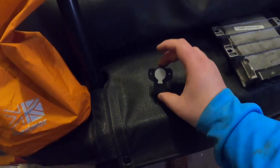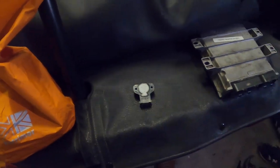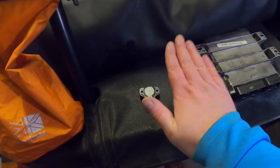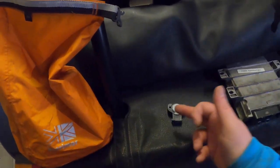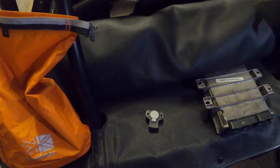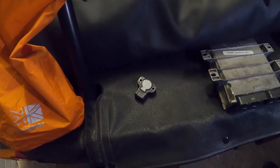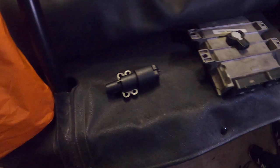The next thing I carry is this weird looking device - a throttle position sensor. This goes back to the early days when I had the car and had a bit of jerkiness and rough running. What this does is measure how far you've pressed the throttle pedal, providing an input to the ECU so it can work out whether it's running the right amount of fuel and air mixture for a clean burn. I've had issues with them in the past so I keep one in the car. Very cheap from a breaker's yard - fits on loads of cars from MG Rovers, etc.